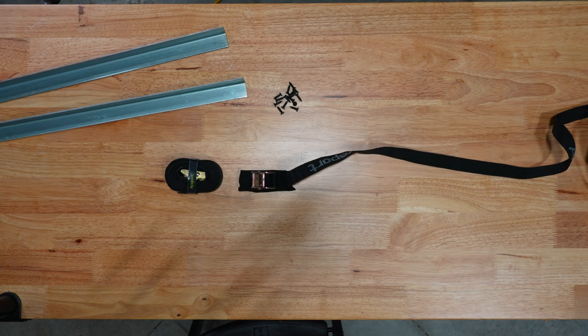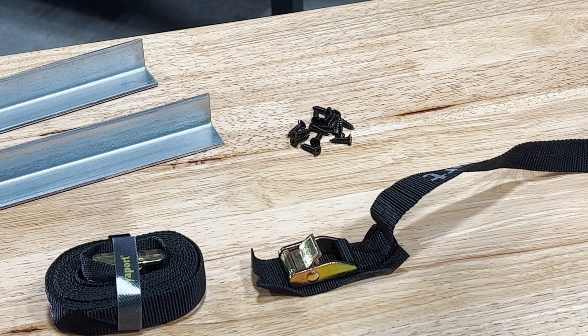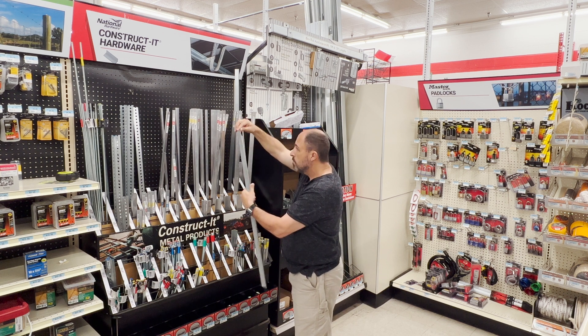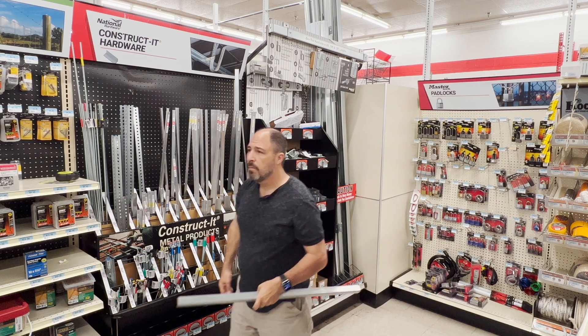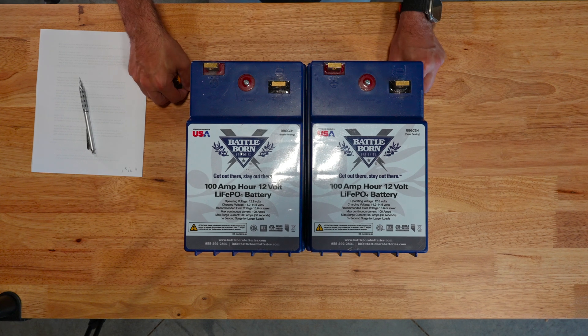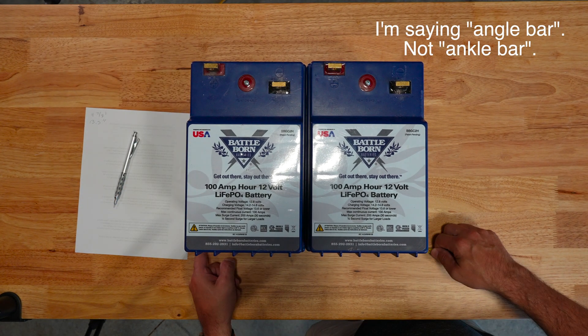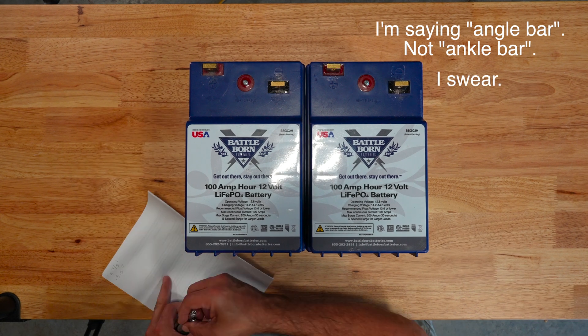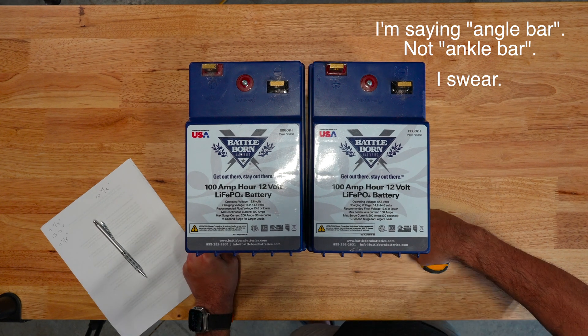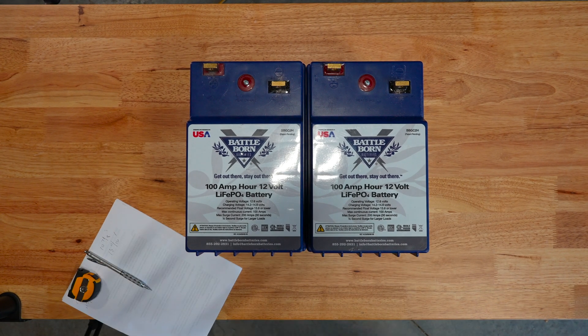When I say this is a super easy build, I am not kidding. All you need are some 1-inch aluminum angle bar, a pair of cam buckle straps, and some number 10 flathead sheet metal screws — that is all it takes. The aluminum angle bar can be found online or at your local big box home improvement store. To determine how much you need, lay out your batteries side-by-side or end-to-end in the same way you plan to install them, then buy the angle bar in increments that best fit that configuration. The angle bar goes underneath the batteries around the edges, so simply measure each side of the combined batteries and buy accordingly.